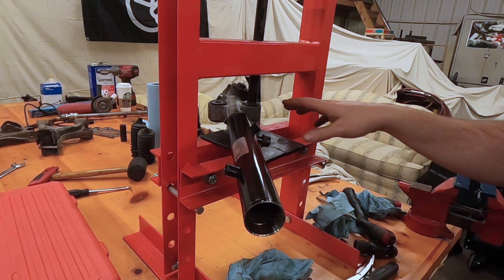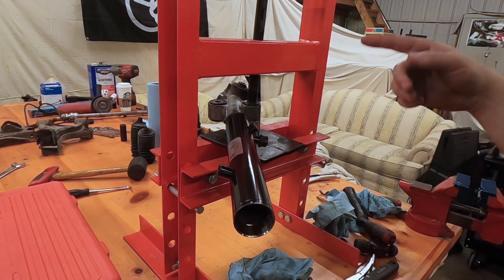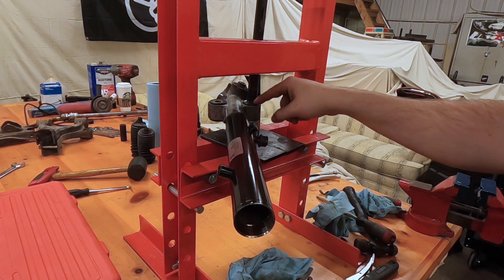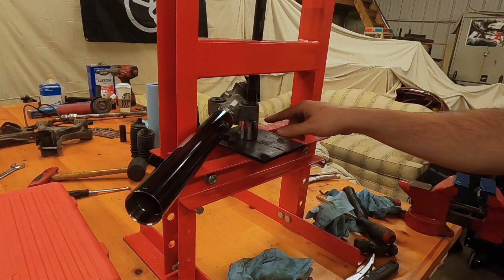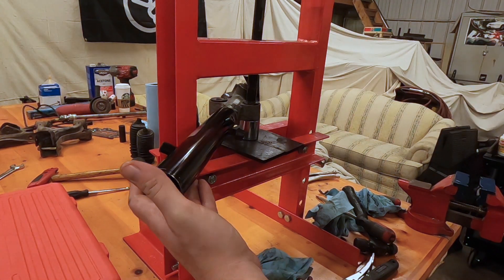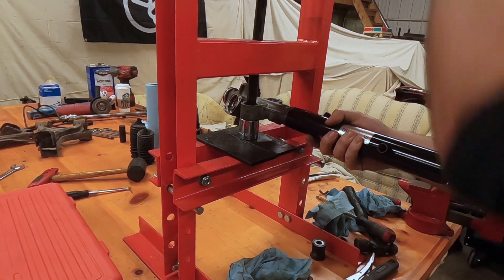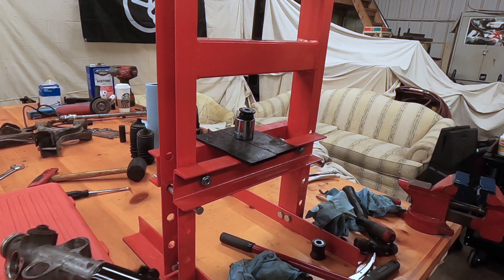This next step is extra because we're going to be putting polyurethane bushings into these pockets. If you have a press, pressing out bushings is super simple. The press is the same size as the sleeve in here - this is a 32 mil socket, a little small for the rubber bushing but perfect to eject the sleeve. So I'm going to take the sleeve out first. That was actually unbelievably easy.